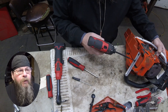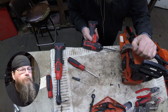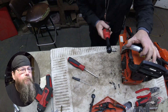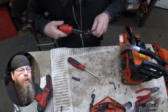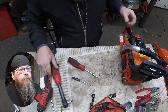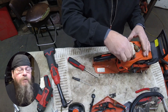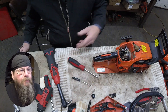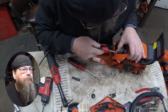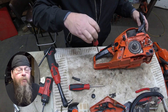We've got the handle on here yet and that's going to be in our way. Everything that's on this tank has to get swapped over to the new tank — the new one doesn't come with a trigger assembly or a few other pieces. Five screws hold the handle on. We're also going to have to gain access to the carburetor because we're replacing a fuel tank and obviously there'll be a fuel line associated with that.